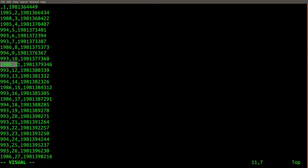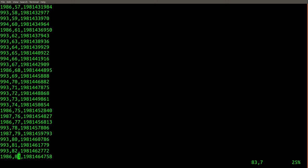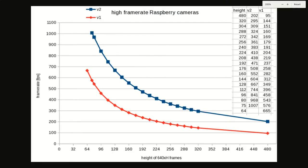You may have noticed that there doesn't appear to be a lot of difference in the output video when requesting 1007 frames per second versus 660 frames per second. A contributing factor is that when requesting 1007 frames per second, the timestamp metadata shows we aren't actually getting 1007 frames per second most of the time — the frame rate appears to jump back and forth between about 1000 and 500 frames per second, even when recording directly to RAM. This diagram, produced by Hermann SW, shows his analysis into the relationship between the requested recording frame rate and the maximum number of vertical pixels that can be recorded. The red line shows the behavior of the version 1 camera, whereas the blue line shows the behavior for the version 2 camera. The x-axis shows the maximum height in pixels of frames that can be recorded at any frame rate, and the y-axis shows the corresponding frame rate. The experimentally observed maximum frame rates presented in this video appear to agree with the values shown in this graph.